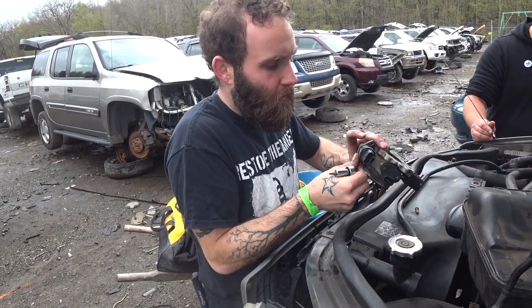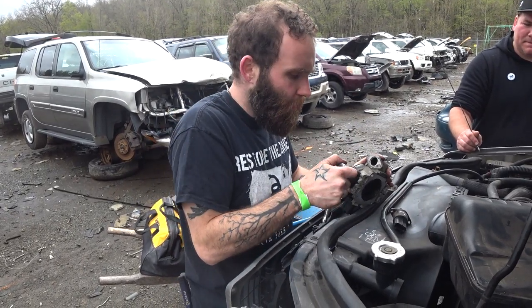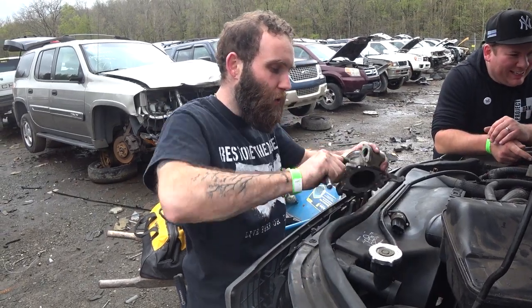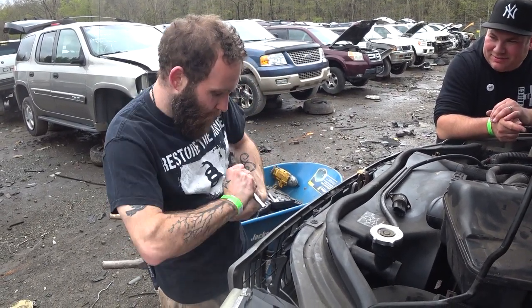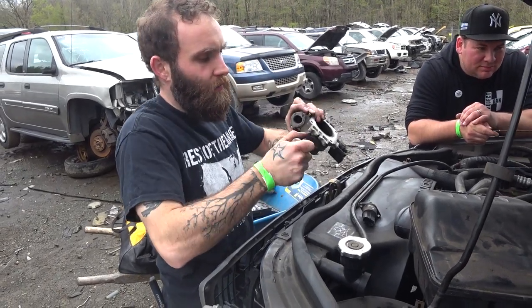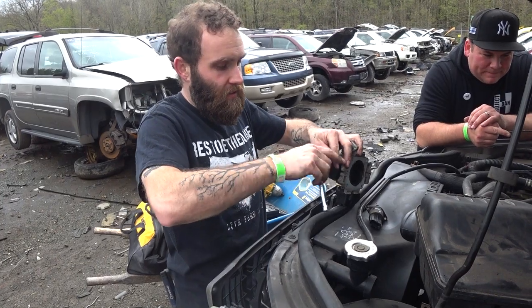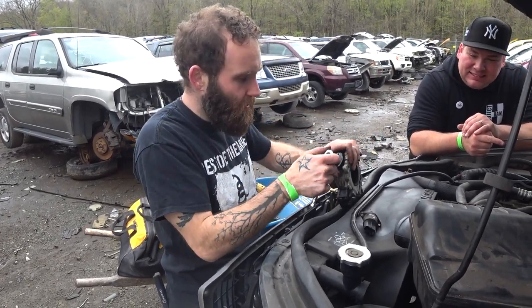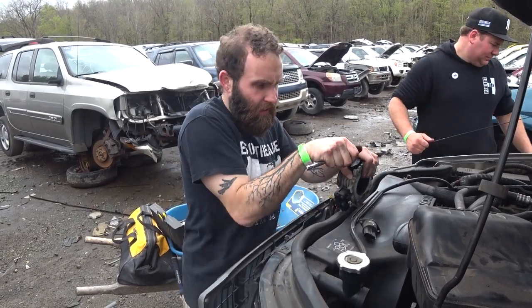Alright, so idle air — there's really not much that goes wrong on them, just clean them. This one's gonna be all full of carbon, I guarantee it. Not too bad, but I would brake clean that and send her on down the road. If anybody needs one, let me know. The next two he pulls — these are just electronic. Somebody asked me how to fix their TPS and I said don't — just buy a new one. If you can't get one of those you shouldn't be driving, cause that's basically a tank of gas. On an old 5.0 you actually have to adjust them — they have the slits in them. So this right here: if you went through a big old puddle and now you're shifting funny, you didn't get water in your trans — you got water up on top of your throttle positioning sensor. It shorted out. They're crazy temperamental on all vehicles but especially on four liters.